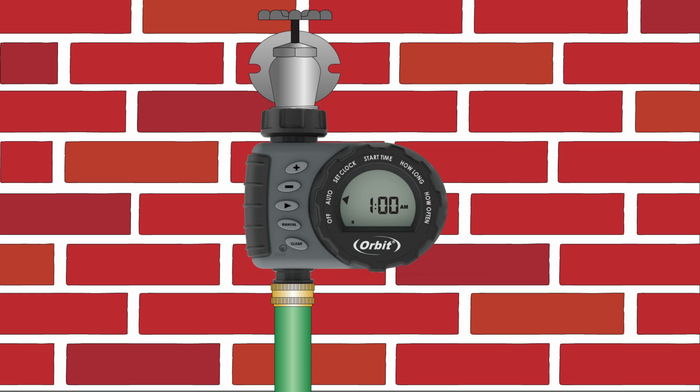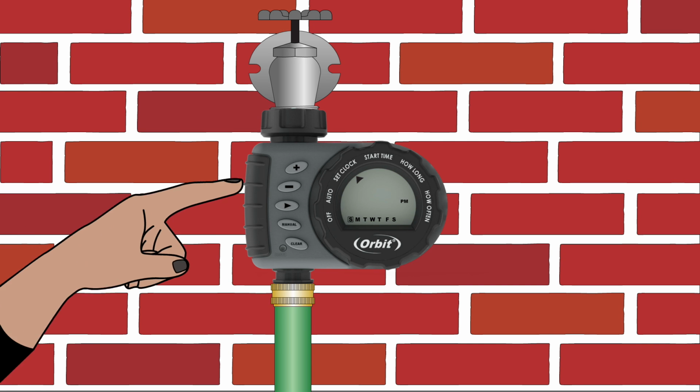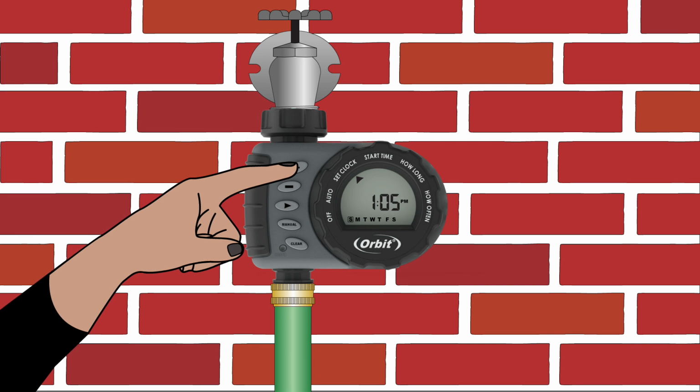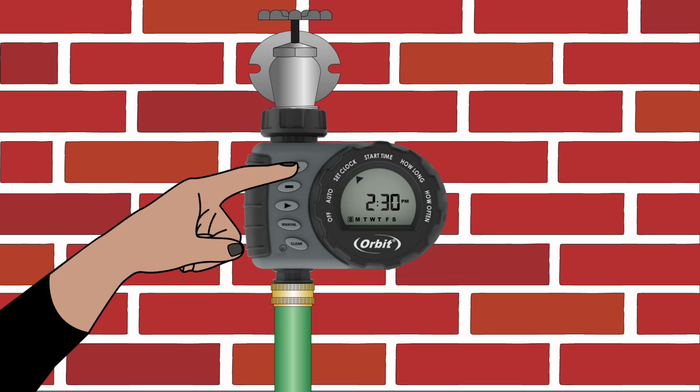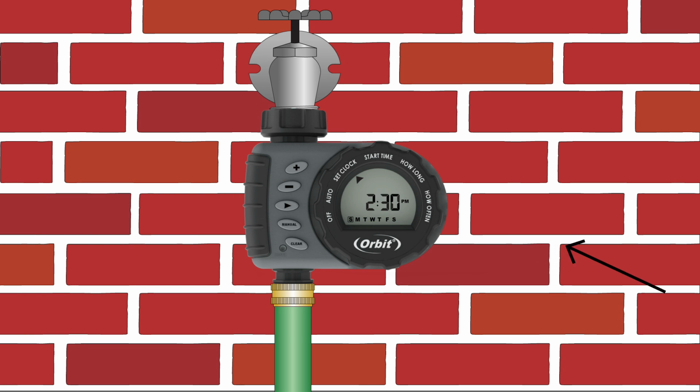Turn the dial to set clock. Use the plus and minus buttons to select the current time of day. Hold down the buttons to scroll more quickly to the desired time. Pay particular attention to the AM and PM.